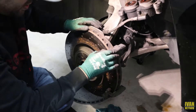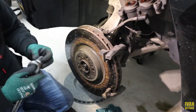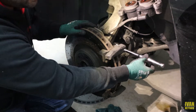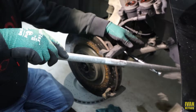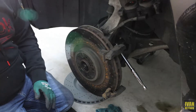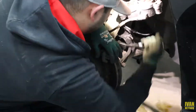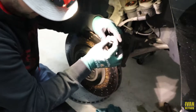I have a wire here prepared and ready — we're gonna hook the caliper so it's out of the way. Next, to remove this bracket: I prepared everything beforehand because those bolts in the back are pretty hard. Here's a tip: get your ratchet and stick a rigid half-inch pipe below the fender, then just push down. That was the only way — I tried a hammer and it didn't work for me.